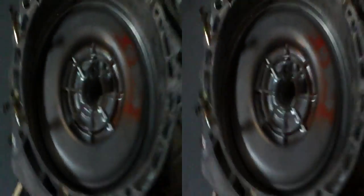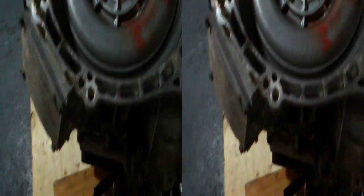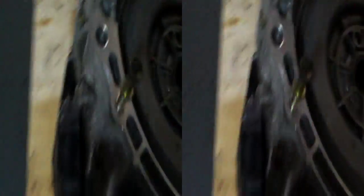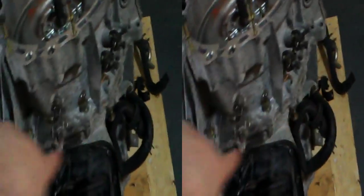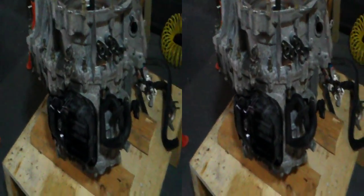Which means this thing around the outside is like a massive circlip, so you should be able to basically take that off. I don't know how it's going to work though, because I don't know what you're taking off. But this here most definitely houses MG1. In this cast housing here, that's MG1, and where it separates is actually where the gearbox is, which is a planetary gear set.